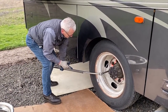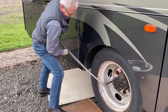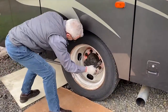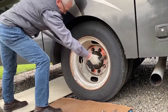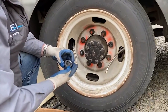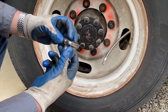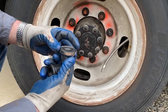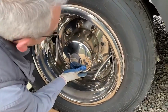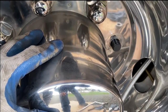Tighten these back down — they need to be really tight, so I'm tightening them about as hard as I took them off. We got the studs in and torqued down, then went and bought extra wheel nuts and some chrome caps with a flange on them, so we've got a good surface to put that wheel cover on. Take a look — now that's more like the front wheel. You've got enough to put them on properly.